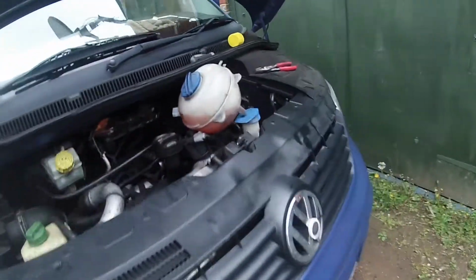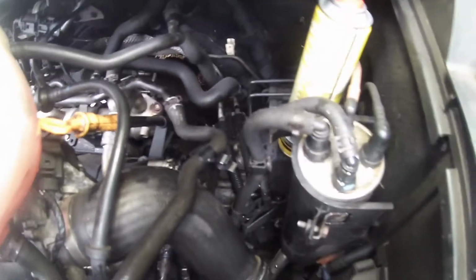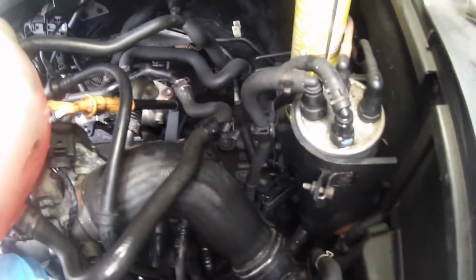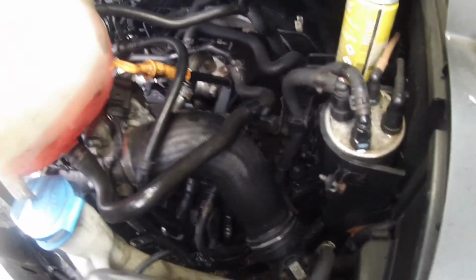I don't know whether you've heard of this problem, but when you look down there, or whether you can see it, there's a nut right down there. And that whole aluminium thread has a spline, and the whole spline is gone. So what's happening is we're not selecting any gears, and it is absolutely annoying and frustrating. It's just gone, literally.